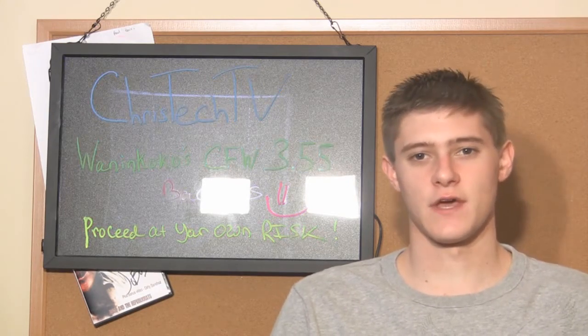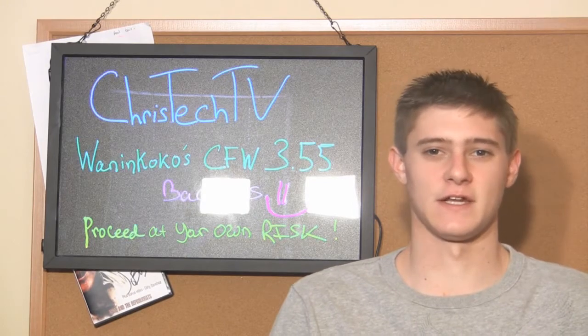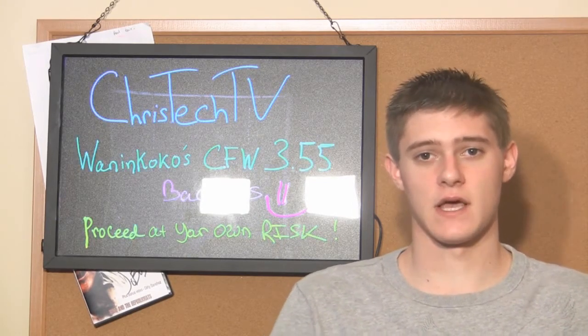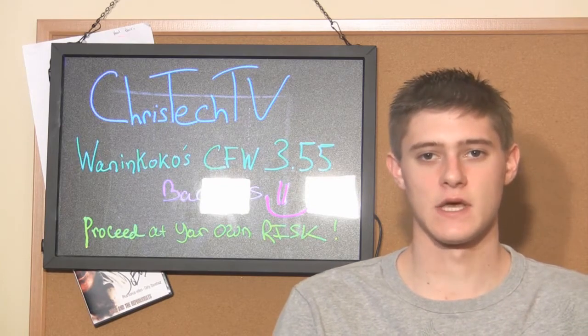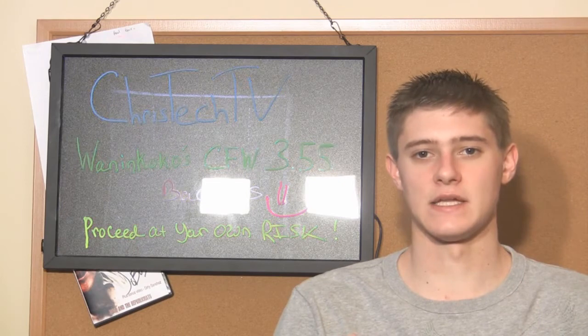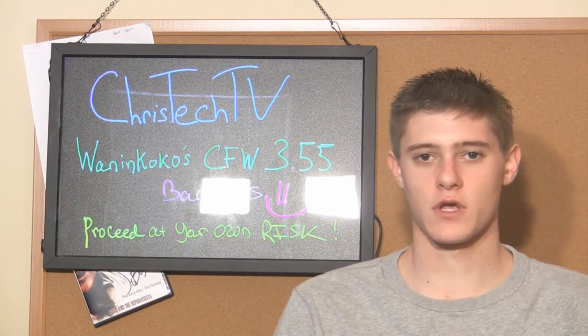This is a really good thing but like all good things there is a downside, and with this one it sounds like a potentially devastating downside. Basically this has bricked a lot of PS3s, and they've compiled a list and figured out that the PlayStations that are bricking are the ones that have 256 megabyte NANDs. So if your PlayStation has a 256 megabyte NAND - that's N-A-N-D - don't do this. Don't do it. Just wait until he releases a better working one.